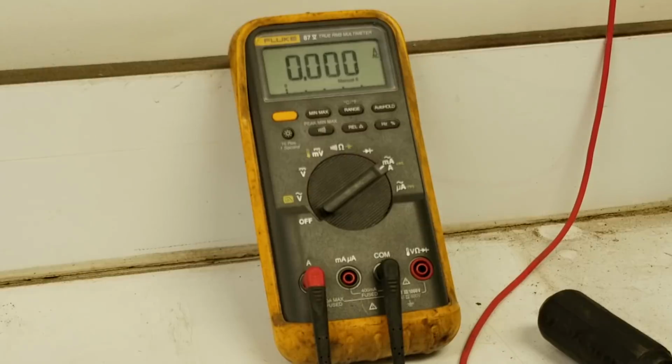So let's fire it up on low speed. Okay, pulled about 8 on startup, or 0.8 on startup. And now it's up to speed, and we're just a shade under 0.7. So 699. Let's go to medium. Stabilized. 0.745. All right, let's twist it off into high. And she's clocking out at 0.864.